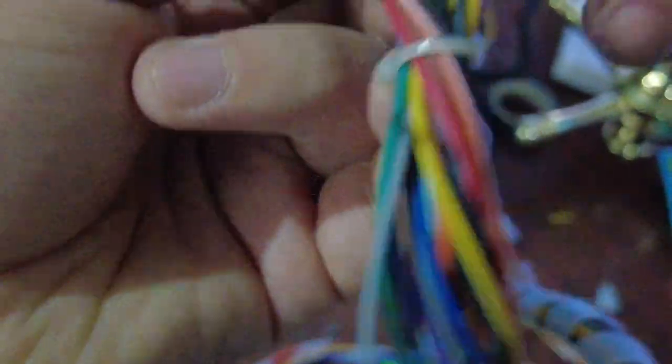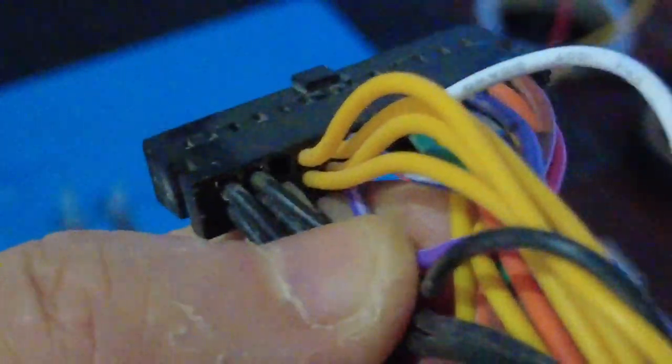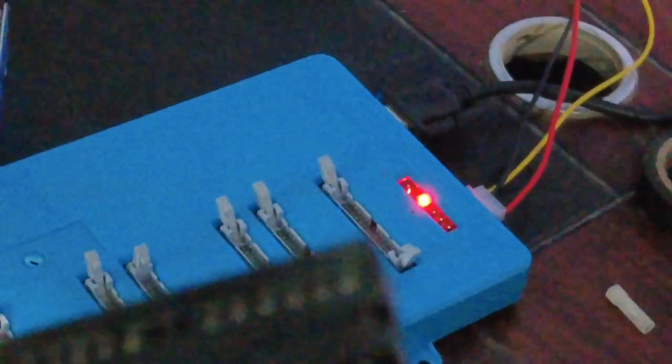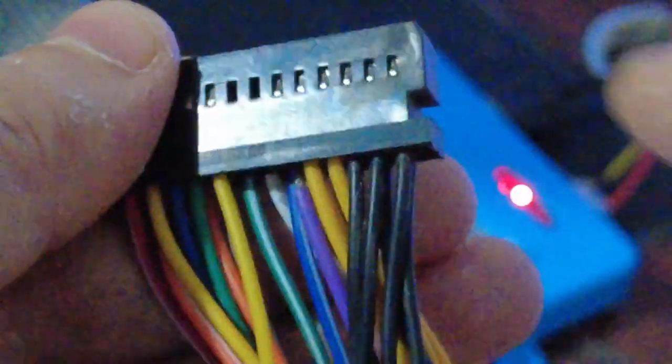The yellow cables — there are four of them. The two cables are on top and two cables are on the bottom. So on this end: positions one, two, three, four, five — number four and number five. On the down side: positions one, two, three, four, five — number four cable and number five cable must all be 12 volts. On the connectors of the fish game harness, there are also several black cables — number one and number two on each side — so four ground cables total. All four black cables are ground. You must be sure this ground cable is this ground cable.